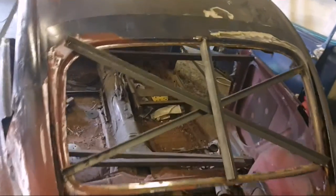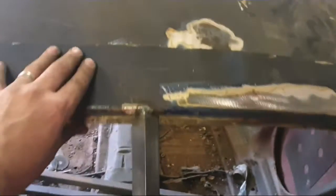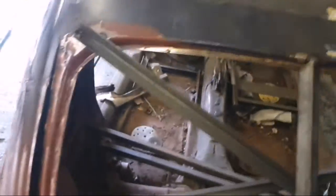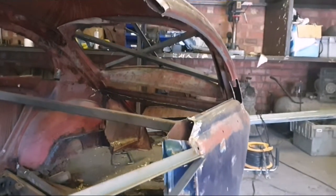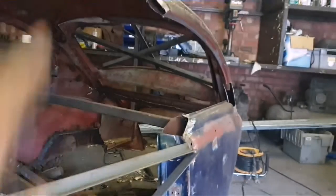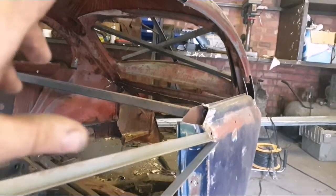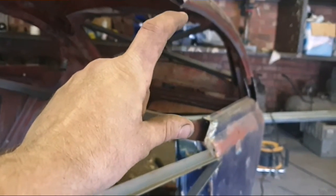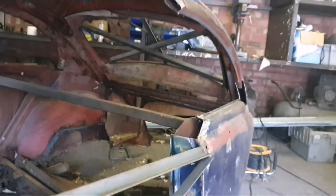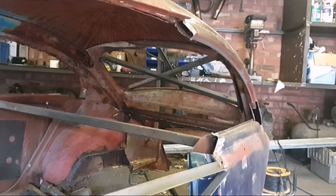Around at the back - tripping up on cable - I've lifted the window up, just shoved it right up about three inches, and then this will all be welded back together later. What it gives me - I don't know if it's going to look right - but when you look through the side window that line follows across the back, so the window is nice and high now. I think it looks better. It's more or less this height when you look through the window - the same as the back window height. So that's where we're going with the three inches.